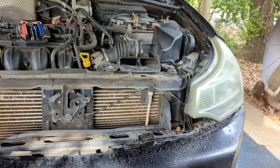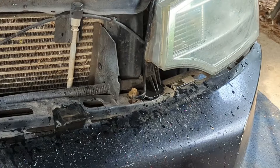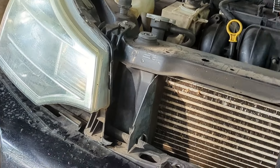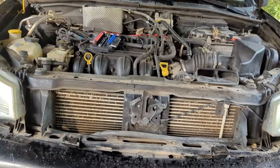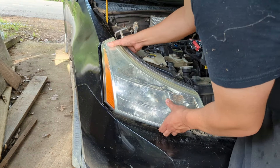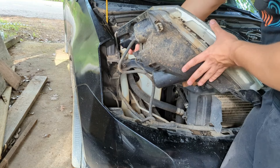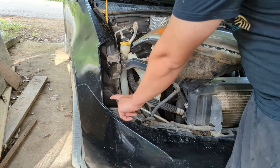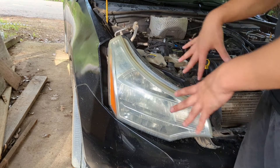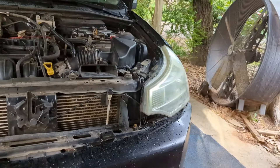With the grill off, you'll see bolts on either side of the bulb — the black plastic is supposed to attach the headlight, but on mine it isn't, so I don't technically have to take those bolts out. But since I'm installing new headlights I will anyway — they are 10mm. To remove the headlight itself, you just come in here and pull. That pops out. Mine was easy because the bottom clip is pretty messed up; on yours, you'll have to pull and wiggle a little more.